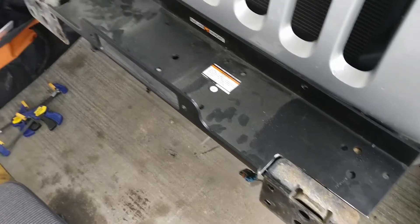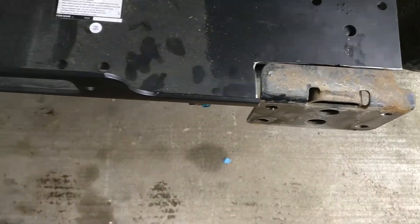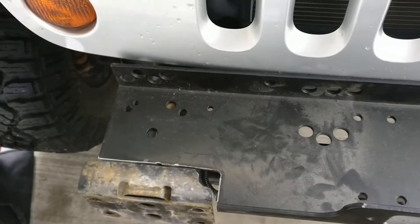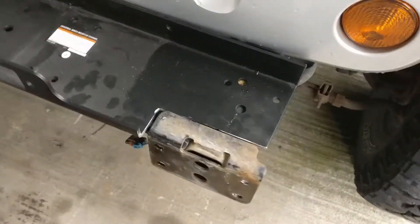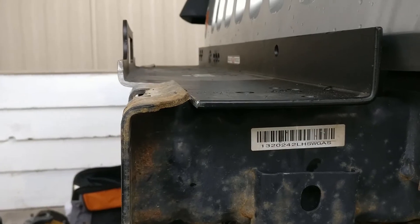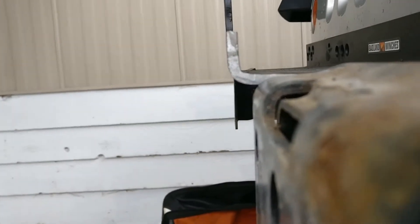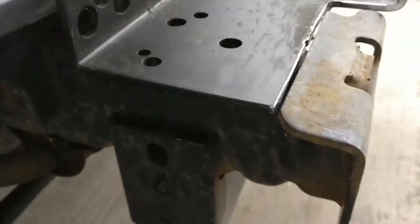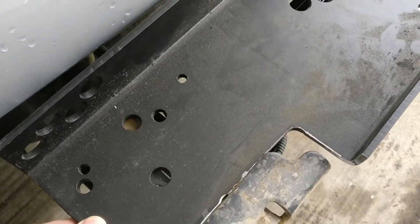It's been about half an hour, so here's where we are. We were able to cut these out with just a four-inch cut-off wheel on a small grinder — it's actually a little four-and-a-half inch Harbor Freight grinder. Worked perfectly fine. This is all ready to be attached. You can see here it sticks out a little bit on the front, maybe a little less than three quarters of an inch — and yeah, I used inches now when earlier I used centimeters, but that's the way I do things. I do have a little bit more play than what I initially planned, and that's perfectly fine. It means I don't have to have it so tight to the grill like I had before.